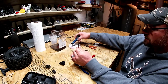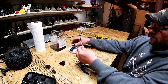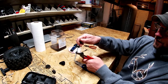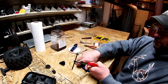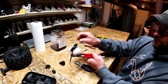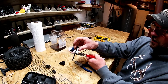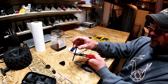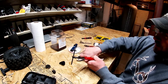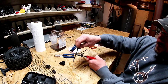This is the shock, the center shaft there in the shock. This was on the inside. All I did was push it up through the center there. On the old one it doesn't really matter, but you want something to hold this rod and to remove this end nut that holds your rebound dampener, or should I say what actually gives you your rate of rebound, with this washer here. It has holes in it. And with another pair of pliers or anything you got, take this nut off. It's a 7mm.